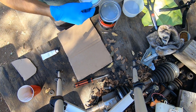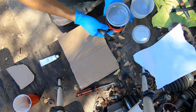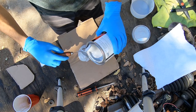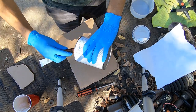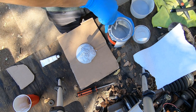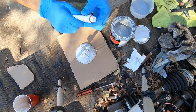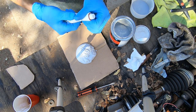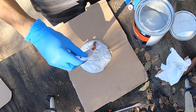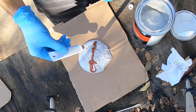With the fiberglass cloth hardened like a skeleton, we are ready to mix the filler. Be sure to mush around your hardener cream in the tube before you open it to ensure it is properly mixed and the chemicals are not separated. Because this was my first time using body filler, I really overestimated the amount of hardener it takes to create a proper mix. The first bit that I squeezed out would have been plenty for the amount of filler on the table.